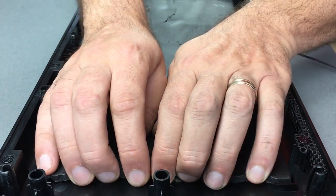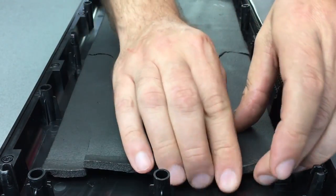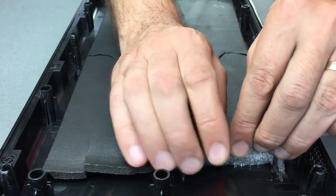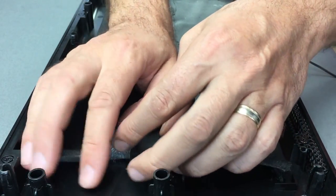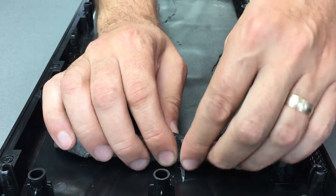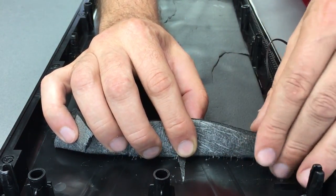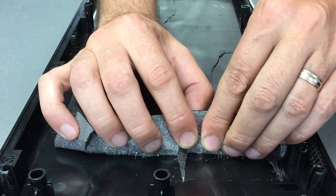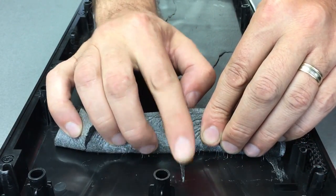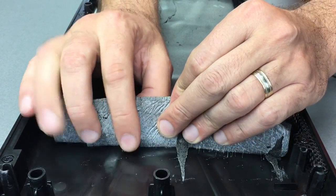Before you start cutting the front of the H440 bezel, you'll want to remove the sound dampening foam on the back side. If you don't do this, it's going to cause frustration later — it's going to gum up your cutting blades and make it hard to determine if you've made a through-hole yet for the jigsaw.